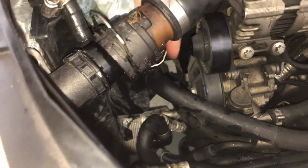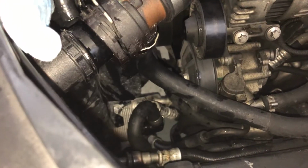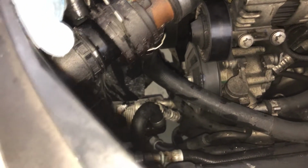I'm gonna give you a nice tip. You see this hose down here? Basically, when you pull it out, it's gonna throw coolant everywhere, and you're not gonna be able to put a bottle on it. Basically, what you do is when you unbolt this, you keep this one down here connected, and then angle this upper radiator hose down like this. So then the level of water is gonna get up to the neck of the radiator hose, and you can actually put a bottle on the end and drain this hose out. Because if not, this hose is gonna make a huge mess like it did on my car.